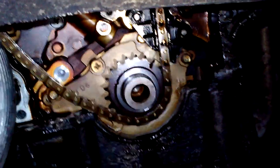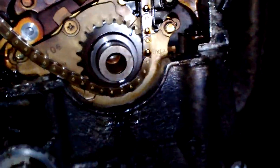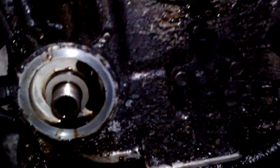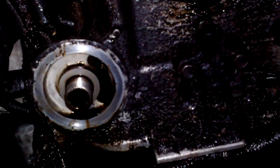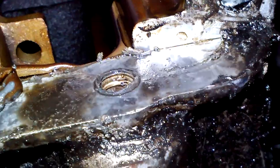Got the timing cover off and giving you guys a heads up on some of these bolts that the books refuse to tell you about. There are three of them. There's a bolt that goes from under the oil pan — you have to drain the oil, there's no way around it. There are two bolts under there. There's one on the left side right beside the oil filter, and the second one is right there.